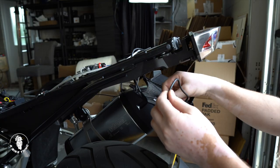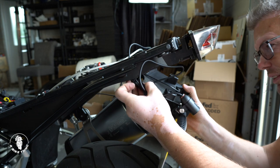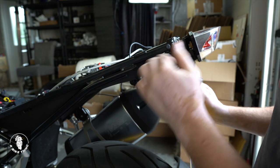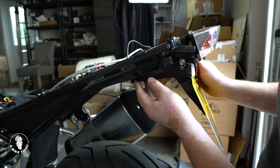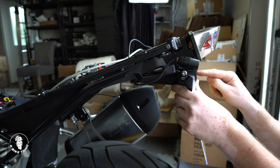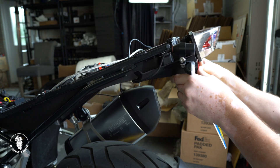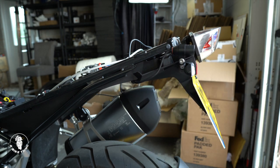Now for the rear camera. The wire routing has to come up inside the back — from experience, if you try to come through the indicator area it gets caught when you close the undertray, so it has to go across the back and through this natural gap they've made in the GS, then up inside. To do this, undo the torx inside here. This piece has a tongue-and-groove system — pull backwards and it drops down, leaving the tongues sitting in the grooves on the undertray. Thread the plug through the same hole as the indicator cable, and that's now in the same compartment as the DVR and GPS. Then feed the tongues back into the grooves and push the undertray back up, securing with the screws.